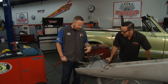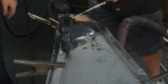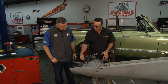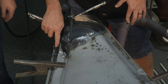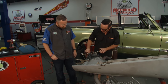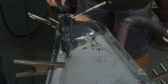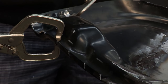We got the fender turned back over. We flipped it over and did a little cleanup — we had a couple of holes from thin metal. We've clamped everything in place. We took the die grinder and made a couple cuts to make it easier to fold over the metal, and we can use those cuts as a guide for where to weld and replicate the factory spot welds. Down here, we took a drill, sunk it in not all the way through, and we'll be able to weld right in the middle of that — that's called a rosette weld, which mimics the factory spot welds that the brace and fender would have been mated together with before.